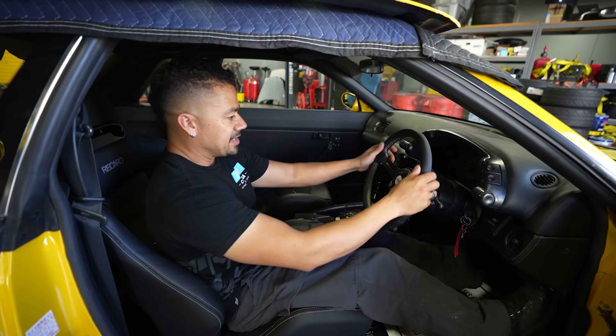We're going to be taking this bumper on and off as we continue to work on this vehicle — this is getting installed kind of early in the phase. So we got to take an extra measure right now. I have some six-pin Deutsch harnesses — I need to cut these and put a quick disconnect right here, just above the bumper where it's meeting the fender, so we can disconnect and remove the bumper.